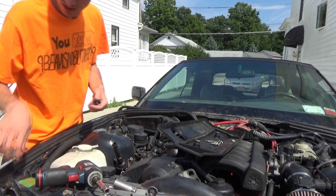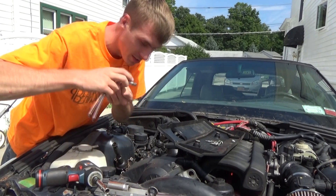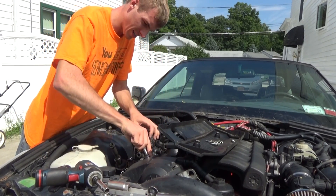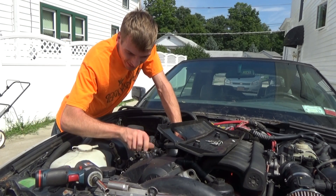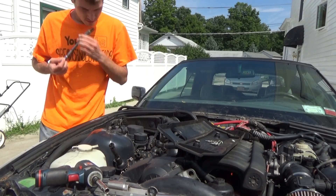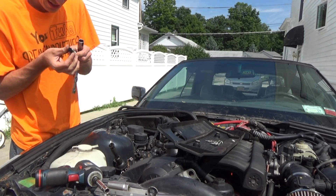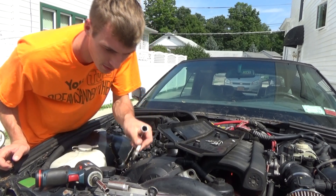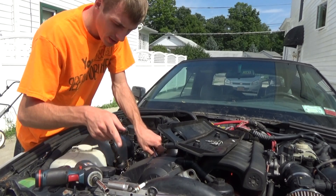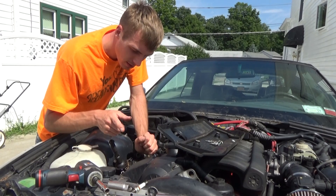So now we'll take the spark plugs out and see how those look — see if they're Bosch. I don't have a fancy spark plug wrench, we're just going to use this three-eighths ratchet. They're tight. Moment of truth. I'm going to go ahead and say it's got Bosch in it. Okay, this smells like gas. The first cylinder smells like gas, and it is an NGK — so it is the incorrect spark plug. Right off the bat, we're down to a crappy spark plug. Fuel is in the cylinder, which is telling me that it's not firing. Whether it's the coil or the spark plug, we'll have to find that out.